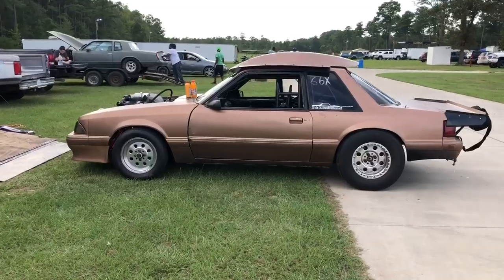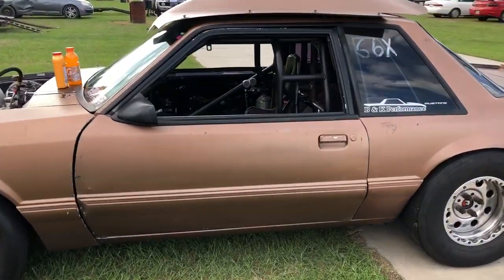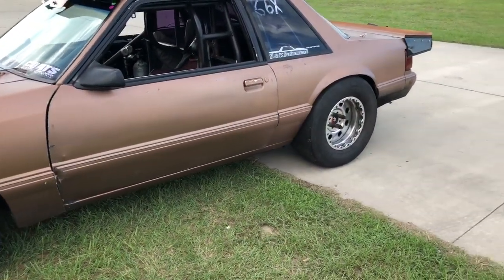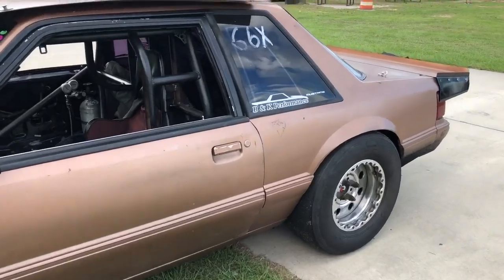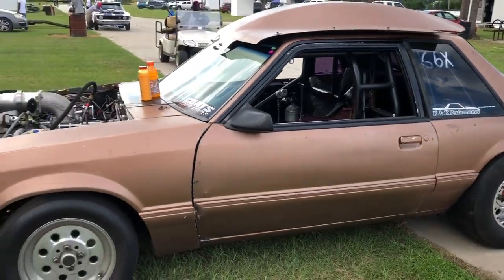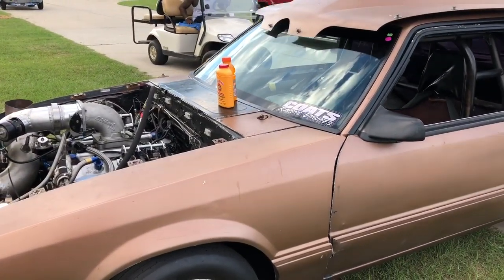My junk is ready. It is ready. All I gotta do is load the tune-up in it from what I had at Galot, the first pass, not the second pass. I'm also gonna jump under there and do an anti-roll bar change real fast, since it did go left a little bit. Shouldn't be that big a deal though. I'm gonna make the driver's side just 1 round longer.